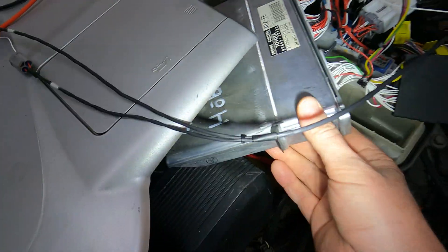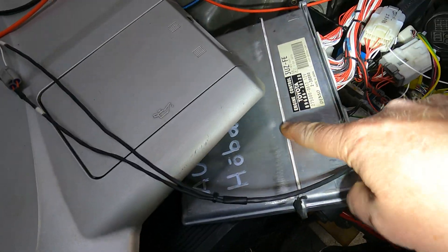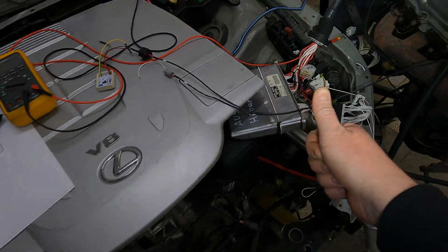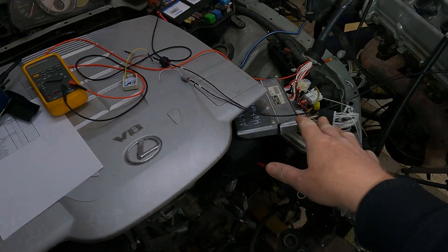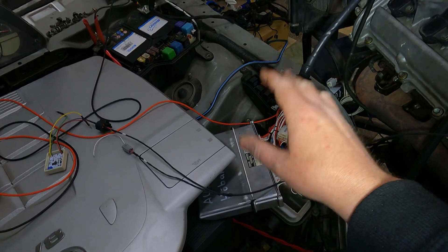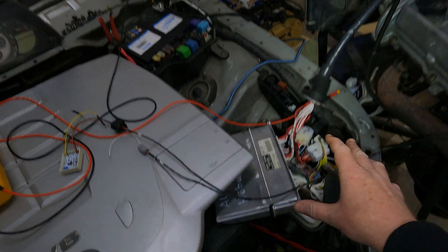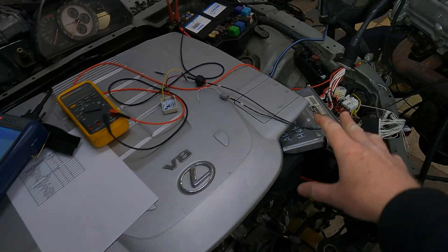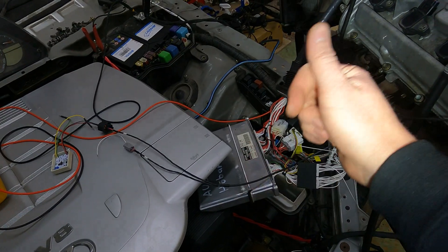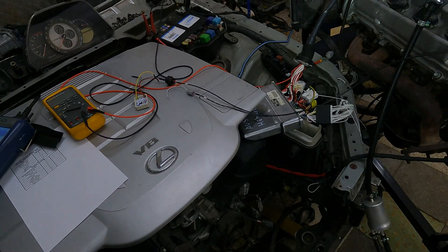So yeah, you can see that's your ECU — it's got your name on it, it's all grounded off where it fitted into the original ECU box. Immobilizer removed, remapped to be manual, so you've got the increased redline to 7000 RPM, we've increased the power, we've increased the throttle response — all set to the complete maximum that we can. So that's all done for you. We'll get the video up, get it back in the box, and get it off to you in Austria so you can get it fitted to your drift car. Alright, thanks for watching, we'll see you later.